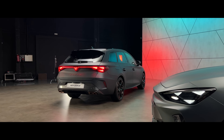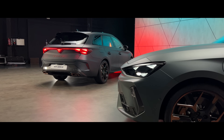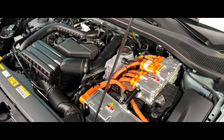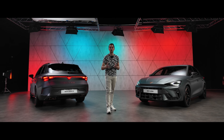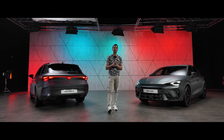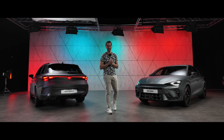There are also two rechargeable hybrid versions. The hybrid engine evolves from the old 1.4 to the new 1.5 TSI EVO2, which has improvements in segmentation, oil management, and cold-start performance for better durability. It will be available in 204 or 272 horsepower. The 300hp version is front-wheel drive, and the 333hp version is four-wheel drive — similar to what we know from the Golf 8 R, released in limited edition.